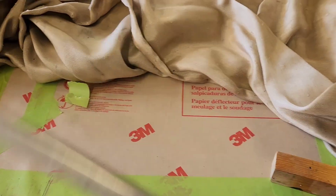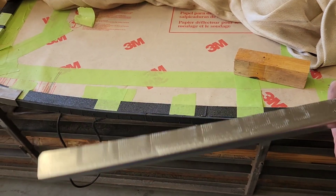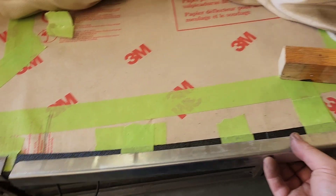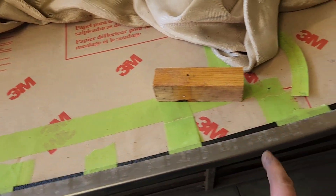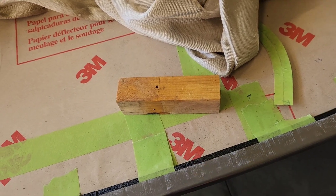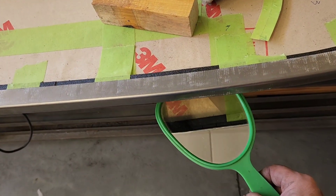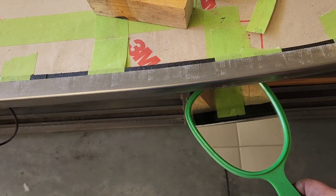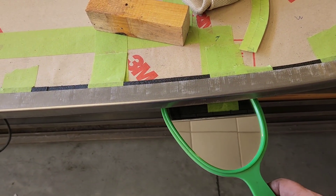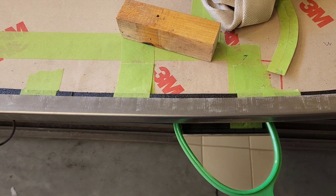I'm working on this intermediate piece, which is a piece of 70 thousandths folded three-quarters by one inch - one inch for the bed and three-quarters of an inch for the depth from the top surface of the finished sheet metal. I'm shrinking and stretching it to get it to comply with the lower surface projected up with these spacers. The difficult part is it's upside down, so I have to use a mirror to make sure it's closed up against that top portion, because that's what's going to show the spacing between the glass and the body of the car - it has to be consistent.